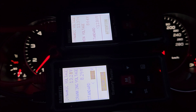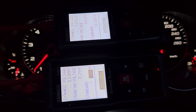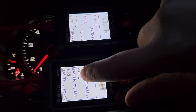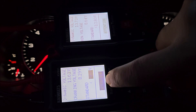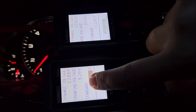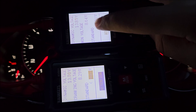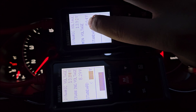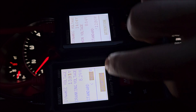It's quite close enough. This one reads a little lower, but that could be because they're connected at different points — I couldn't connect them all to the same place. For the loading test result readout it's fine, but for the cranking test the problematic unit doesn't give a clean pass/fail result. You'd need to read the value yourself rather than relying on the automatic verdict.